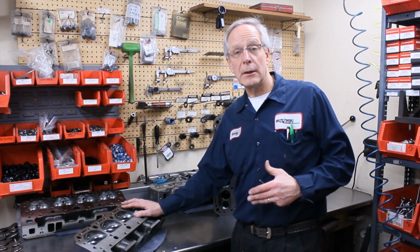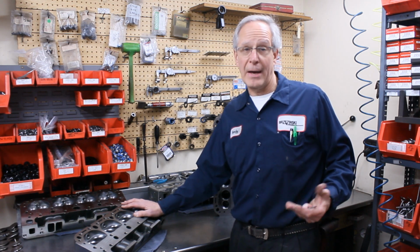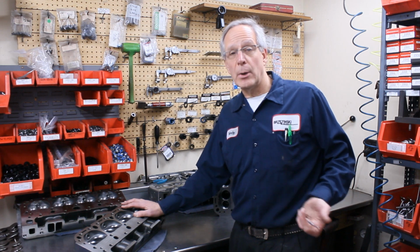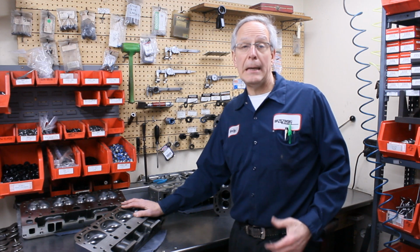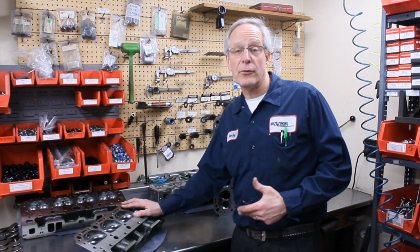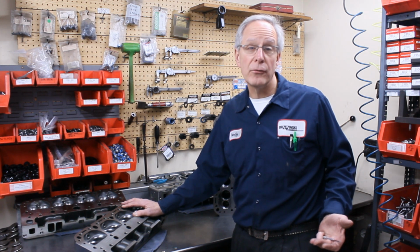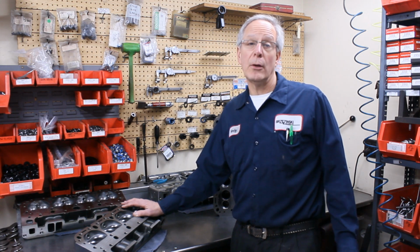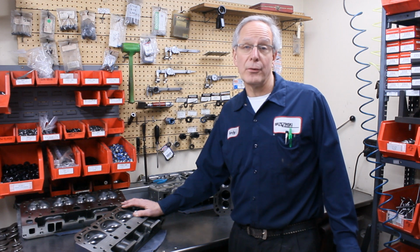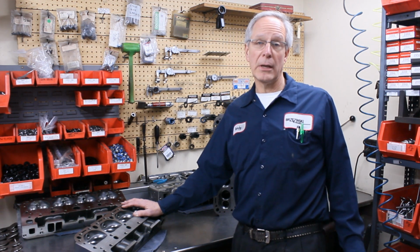So after we're done selecting the cylinder head and pressure testing it, we pre-sort them. Now, pre-sorting, what is that? Well, the cylinder heads are somewhat haphazardly machined from the factory. These are production pieces, and they're not very accurately machined, especially some of the stuff coming from Engine Quest, the 350i, the 350Cs. Valve guides are all over the place, seat machining is all over the place. And if you're running a 194 valve in some of those cylinder heads, you're not going to have very good performance if you choose the incorrect casting.